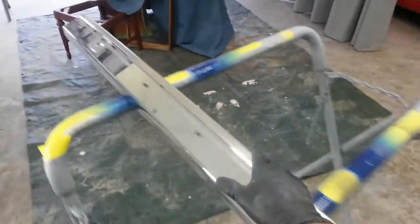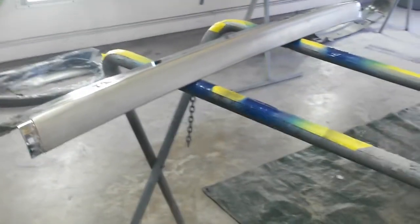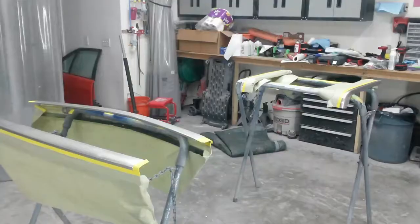There are just typical ripples along the top from it being an aftermarket part. Since I've got to prime it anyway, might as well just wipe some filler down it and block it out — it won't take any time at all, just run a block down that. I'm gonna hit the center piece the same way, and then the two rear end pieces and this left front piece. While the epoxy is still fresh I'll wipe filler on all of it. I've got all these metal pieces ready to epoxy — got all the chrome sanded down. I'm just gonna paint down to the end of the back edge of this molding where it overlaps the rib.